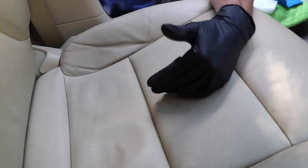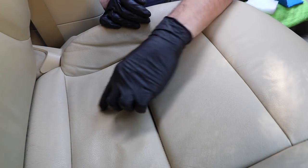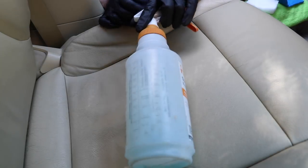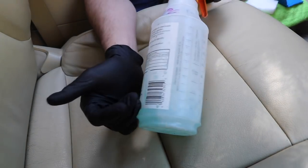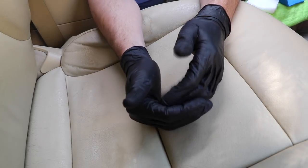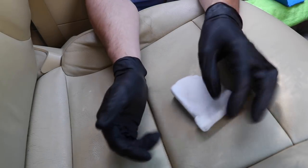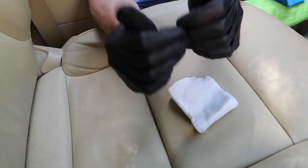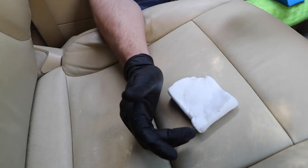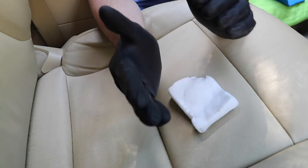Though this is not the best angle, it does give you a view of both panels. I'm going to test the non-abrasive scrub pad on one panel and the Magic Eraser on the other. For this video, I'm using a dilution ratio of 10 to 1 for Meguiar's all-purpose cleaner. I chose a lighter cleaner rather than Super Clean or a degreaser because I want to let the tool do as much of the work as possible rather than the cleaner.